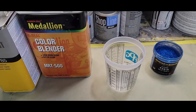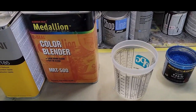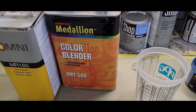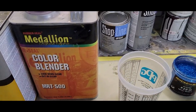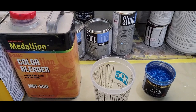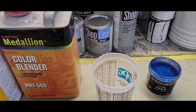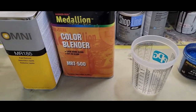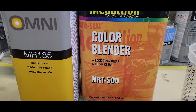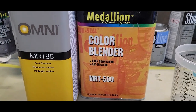Okay, we're back at the bench. Like on one of my other videos, I'll show you how to mix this again. This job is a little different because we're doing the stripes first and then the black base coat last, since that's thinner. Another reason to do it last: anytime you have a medium to larger flake, if you do the black first and then do the stripes, your edge won't be straight because the flakes will be overlapping the fine line. It's 7 o'clock Monday morning, about 55–58 degrees out here in Tampa.